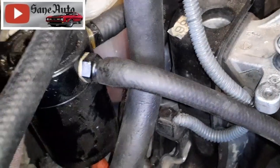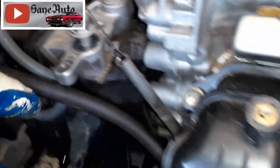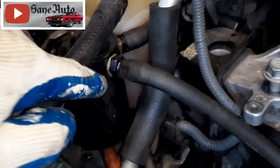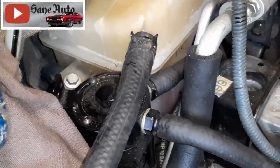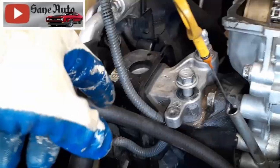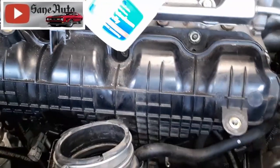With this setup, the vacuum is being pulled into the intake from this hose, which goes all the way here to the catch can. The vacuum is pulled through the catch can, comes down the other hose, gets pulled through the PCV, and pulls all that gunk from the crankcase through the catch can — where the gunk falls and accumulates. I did not use the little filter at the top because I wanted to actually pull the vacuum out of the crankcase. There's still some gunk that goes down the other hose into the intake, but you get much less of it.